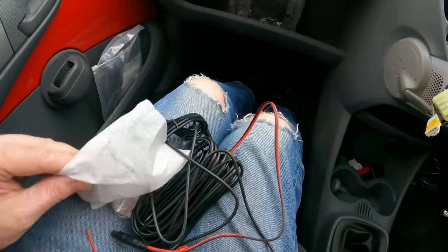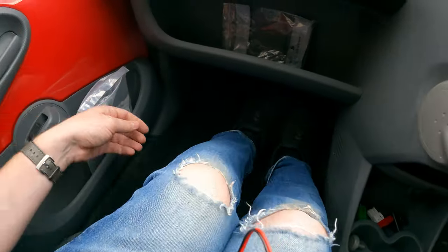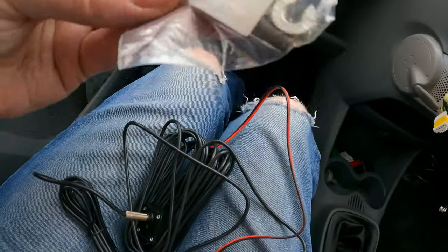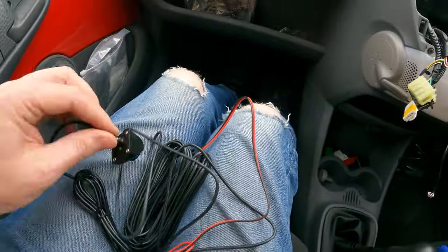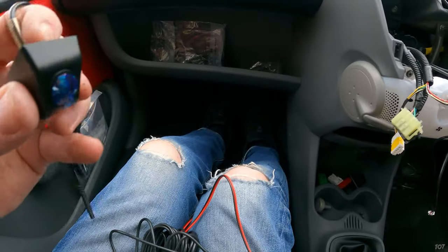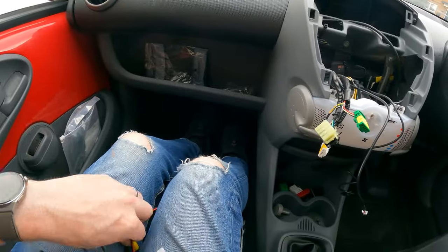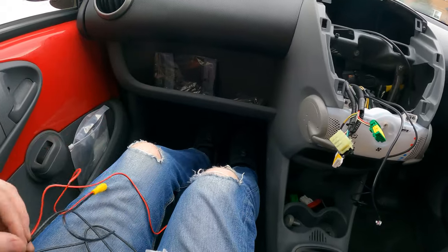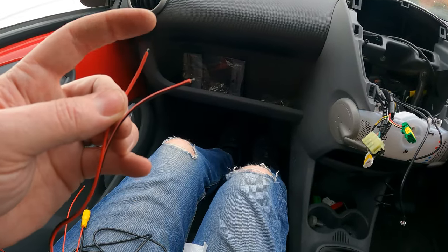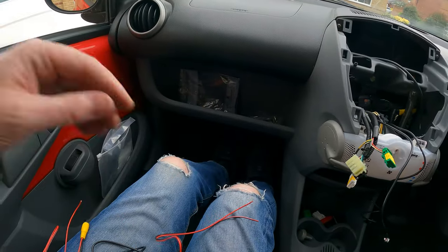Time to have a look at our reverse camera. We have the camera itself, and it also came with a little drill and some screws. The plan is dead center above the number plate on the back — drill a hole, feed it through, screw it into place. There's a stick-on gasket for the back of it as well. This is the cable we need to get to the back, and when I've done these installs in the past you basically just need to find an earth point at the back. This I normally hook up to the reverse light — as soon as you put the car into reverse, it energizes the circuit and sends the signal to the camera to switch on, which will automatically bring it up on screen.